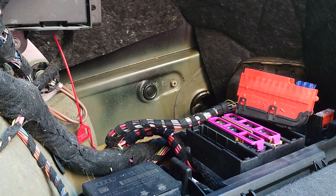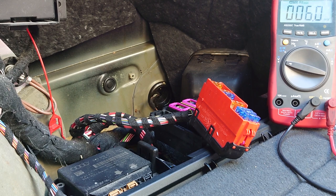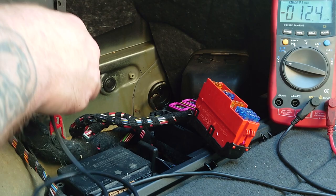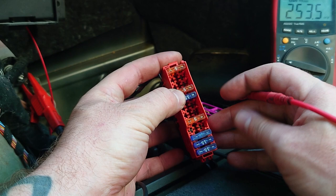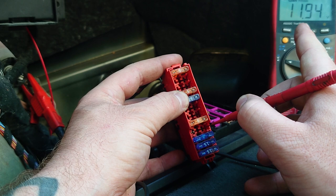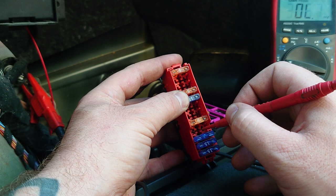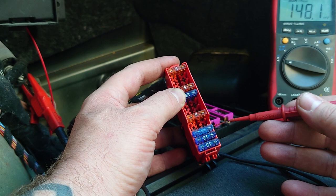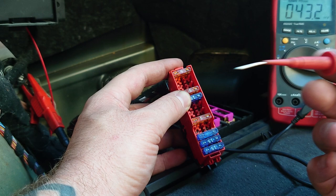Our first quick check is to see which side of the fuse holder has voltage on, so we know where the voltage is coming from — the other side should be going towards our cigarette lighter. We've got our multimeter set up on volts, black lead to earth, red lead to the fuse terminals. The first terminal shows 11.9 to 12 volts, and the other side has no voltage — just a few millivolts flickering. So we know this side is the feed into the fuse and the other side goes toward the cigarette lighter.